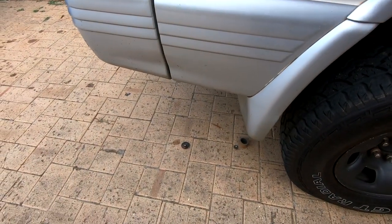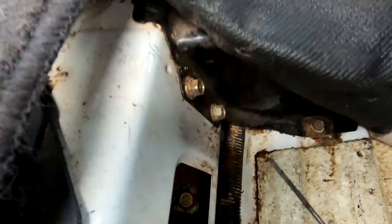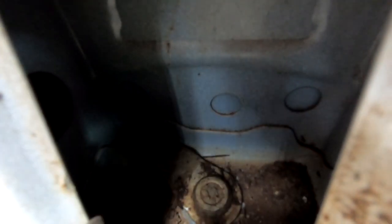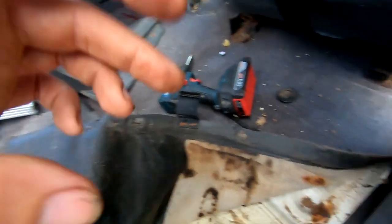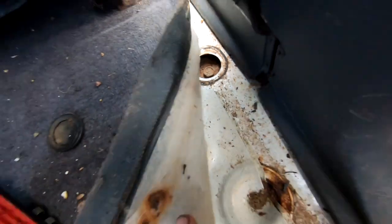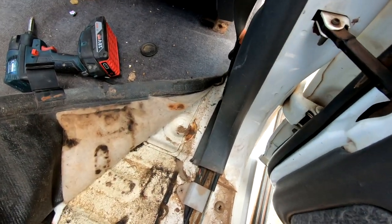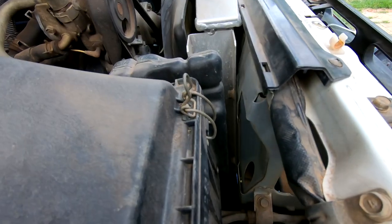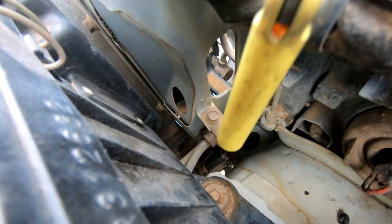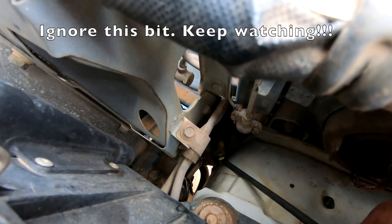I've just gone around to start taking all the nuts off the bottom. The type of bolt I was trying to describe before — see it's got a little bracket on it. The ones under the grommets that are easily accessible are actually a normal bolt — for those ones in the drivers and passenger front footwell you will need to put a 14mm socket on there. Now I've got the nuts off all of them, we need to get the bolts out. Most are relatively easy to get out except this front one because it's all the way down there. If you have a telescopic magnet, this is the time to use it.